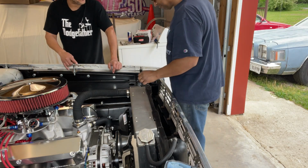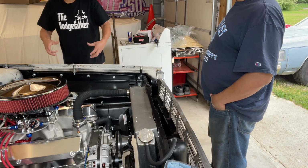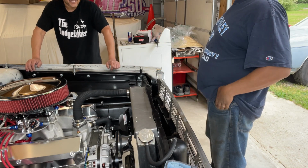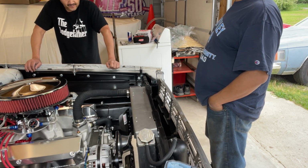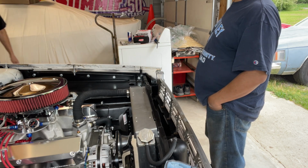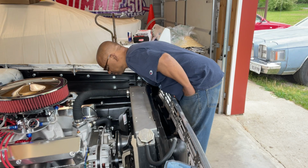See, this rack and pinion. That's what I'm saying. The steering is right there. It's just, he don't have the upper control arms adjusted. Yeah, that's what he's got to do, and when he does that, it's going to really turn like it's supposed to. That rack ain't like that old Mopar I got on there, man. Gearbox got play in it. I mean, that steering is supposed to be right there, and it's right there. The tires are moving, and I'm just touching it.